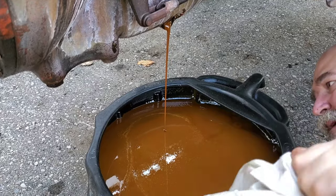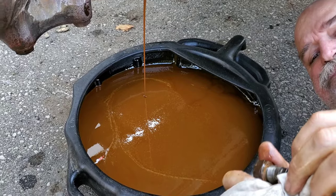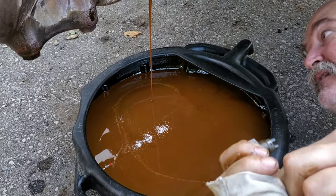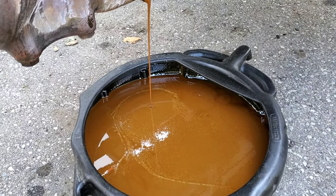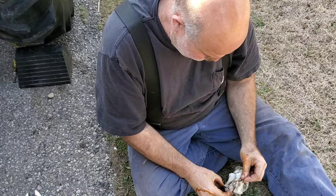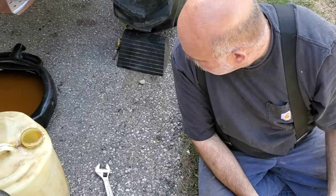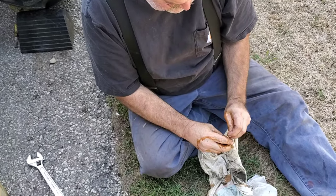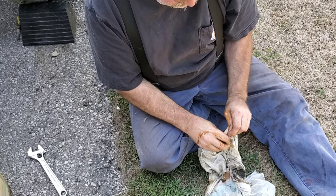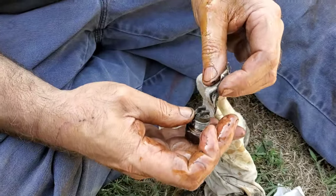And I'll tell you why I don't mind the fact that there's a hypoid gear oil in this: it's extremely important that you do not stress the ring and pinion in these things, because one, they're ultra hard to find, two, they're ultra expensive, and a lot of guys are using stuff like all-in-one oils, universal fluids they're called, and I'm not buying it. I don't see the logic behind it, to tell you the truth.